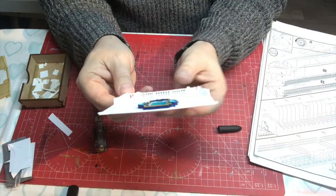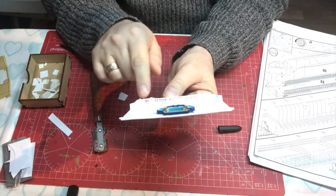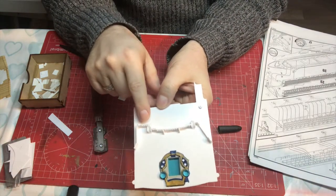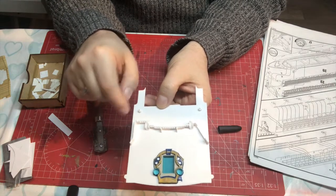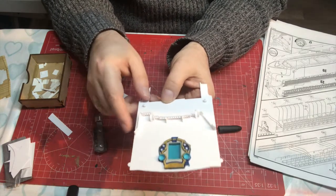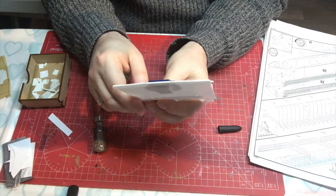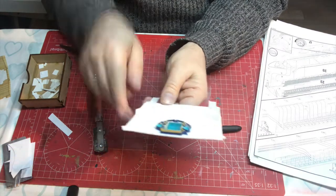That fills our hole. So what we've done is we've widened it so that we can level it, because this bulkhead was not at the same level as where the turn was on this molded in bulkhead. So we've just cut that off, which created a bigger gap than we already had, which becomes easier to fill with big stock. So we'll just let the glue dry and then we'll sand that back and it should all look good.